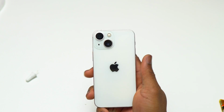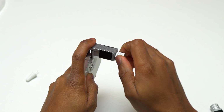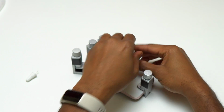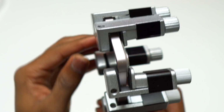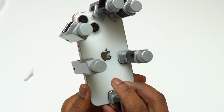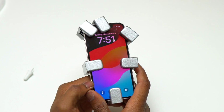Also, since Apple didn't have any plastic on their back glass on the inside, you should remove the double-sided tape that is on the back of the back glass before you install it with B7000. The next step is going to have some clamps apply pressure on the device and the back glass altogether. You can leave the device like this for 10 to 20 minutes before removing the clamps.